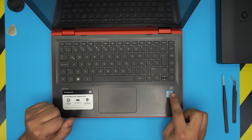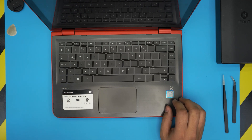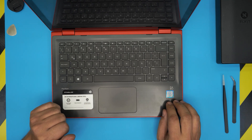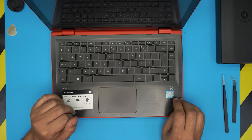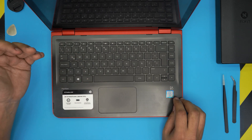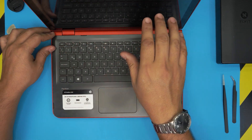These are Intel CPUs, and if they overheat they throttle and the speed goes down a bit. To prevent that, we're going to do a repaste and clean up the fan, then put everything back together. I'm going to take you on a step-by-step tour of this process. This applies to any S-series laptop — it doesn't have to be S101, it can be S200, S102, it doesn't matter.